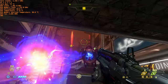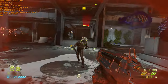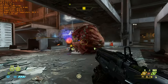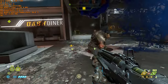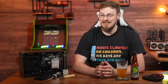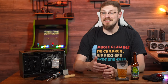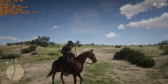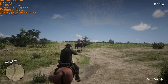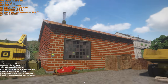In Doom Eternal, the CPU maxed out at 81 degrees Celsius with the Dynatron fan set to just 50% speed. But this is a title that is almost entirely GPU speed dependent, so overall CPU utilization was sitting at around 5% the entire time, with only a couple threads seeing any significant workloads. Still, the CPU did pull 98 watts at peak power and didn't seem to be climbing in temperature beyond that. Unfortunately, most other games I tried wound up being CPU speed limited in single-threaded tasks only. Red Dead Redemption 2, Project Cars 3, even Teardown with its system-melting physics — I couldn't get temps on the CPU to climb above 70 degrees Celsius, let alone the 81 degrees observed in Doom Eternal.